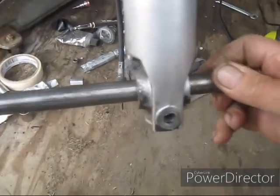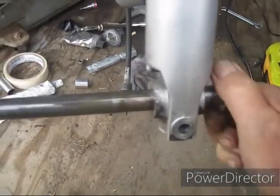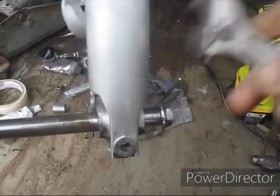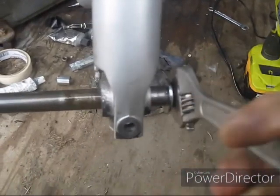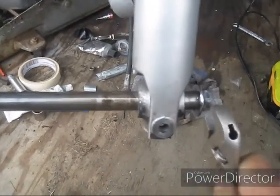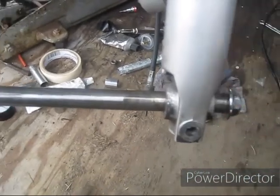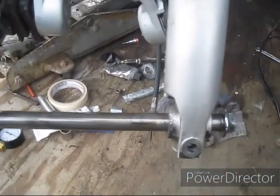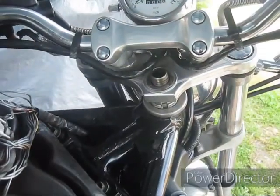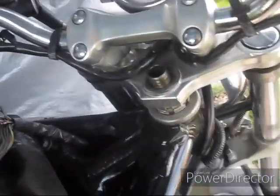I have to change the discs on this — it's another thing I need to do. Be careful with your speedometer sending unit. You have a spacer here that goes into the front wheel, so you want to make sure you don't lose that stuff. I'm just going to stick this axle back in here for now. I've got another axle in the other front end, but this should keep it together and help me pull the whole thing apart in one piece. I've got all the pinch bolts loose.